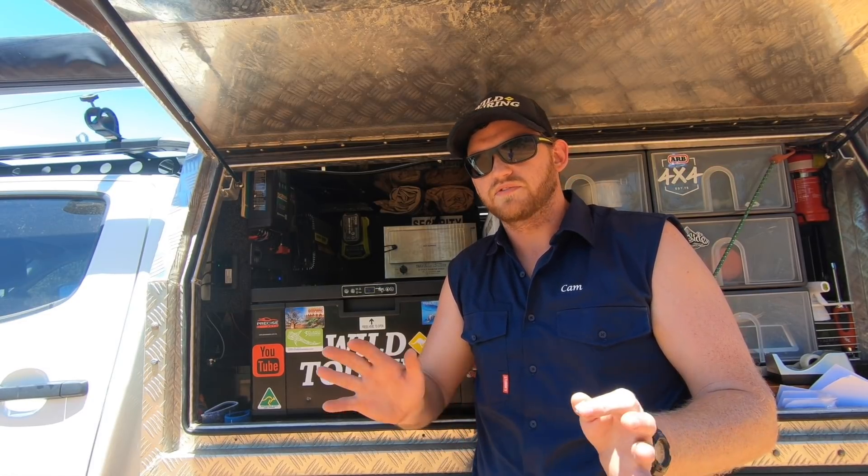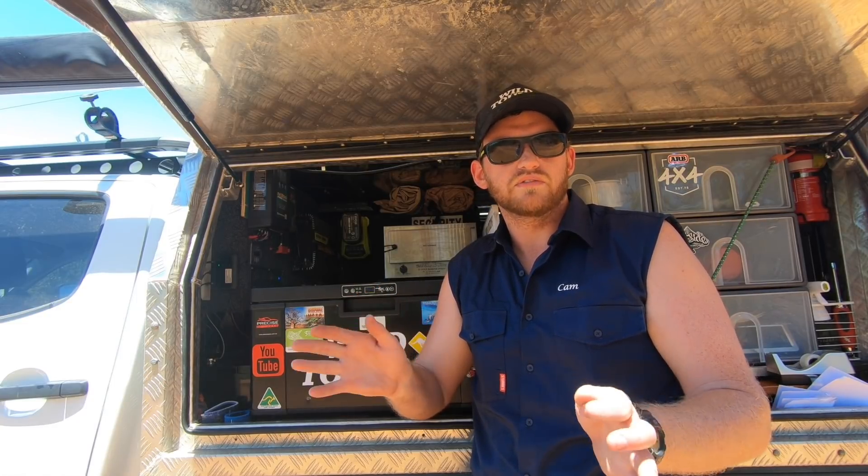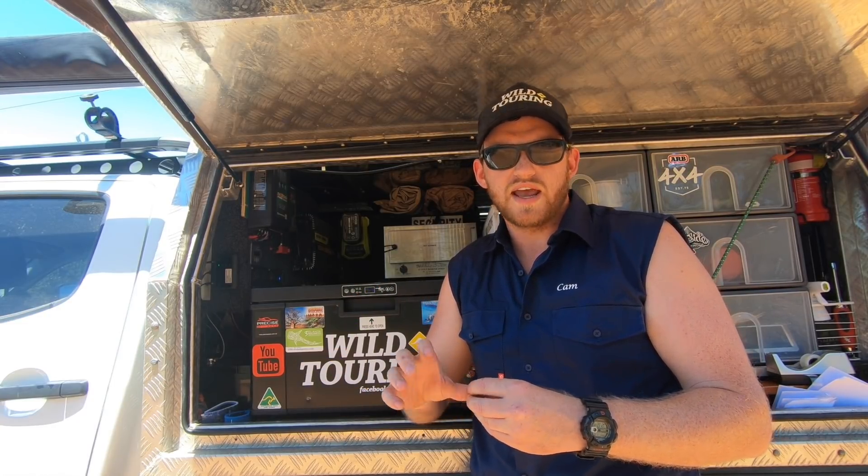As far as the safety of lithium goes, there's a bit of confusion out there. There are a couple of different types of lithium batteries. The most common are lithium iron phosphate — LiFePO4 — and then you've got lithium ion and lithium polymer. Lithium ion and lithium polymer are the most energy dense but they're not very stable; these are the batteries you've heard stories about catching fire and exploding. LiFePO4 are the safest — they don't overheat, won't catch fire or explode even if punctured, and nothing inside them poses any health risk or environmental hazard. The chemistry is so stable you can actually charge them with your standard lead acid battery chargers.